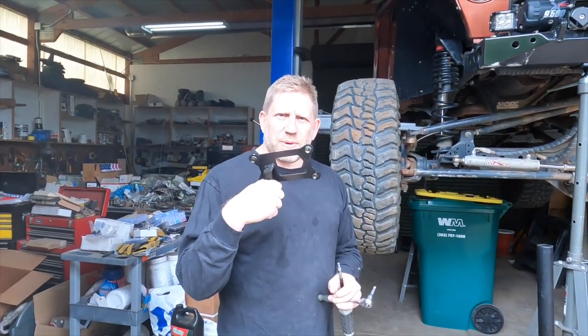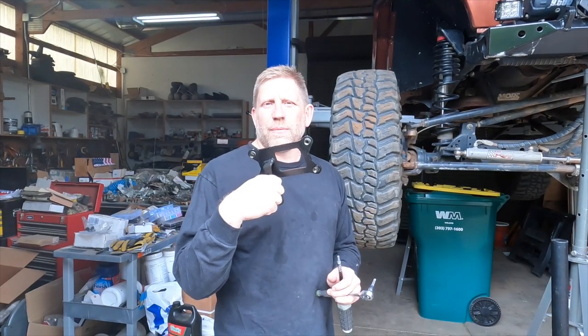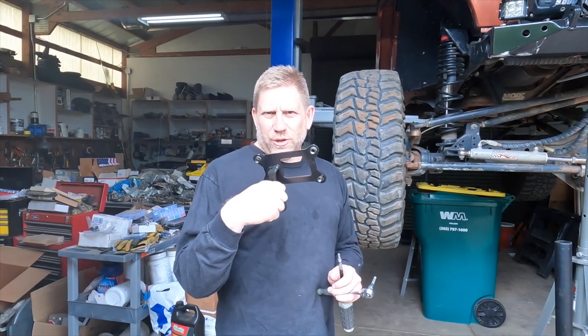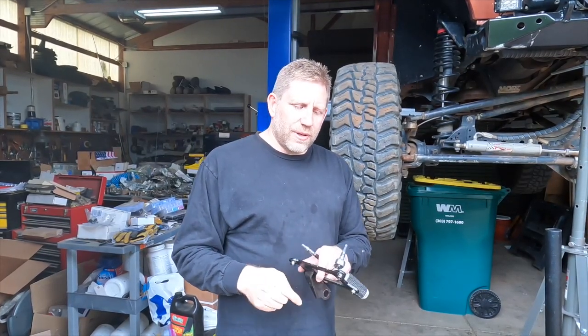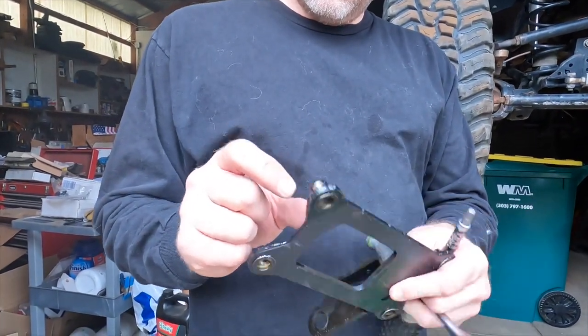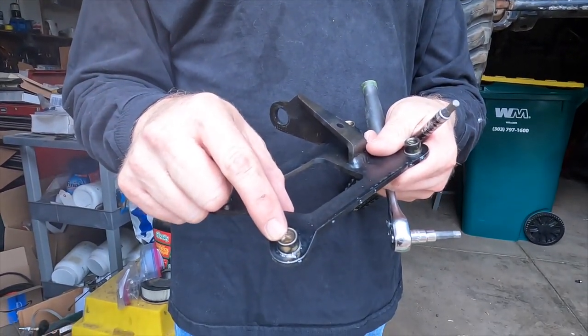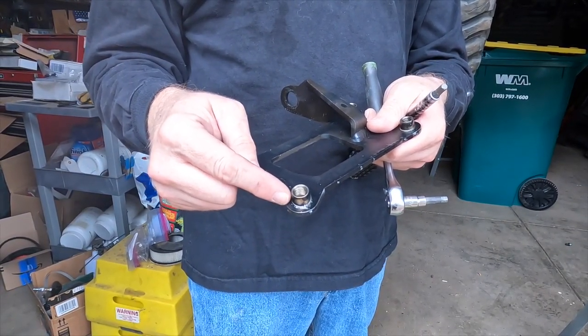One week later. All right, picking up from where we left off, we have our replacement bracket for the shift linkage. This is the one that goes on the side of the body, and it's the one that had come loose and then sat there and danced around on top of the drive shaft and got banged up. We ended up opening up the holes just a little bit to allow us to install a nutsert. And it was a case of finding one that was going to get close enough to work.